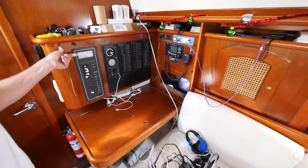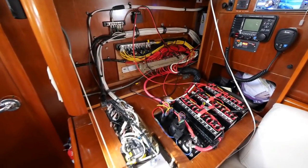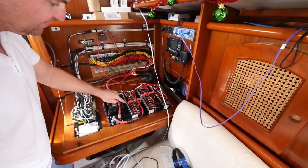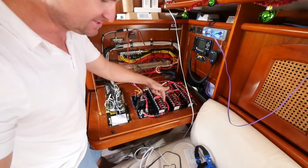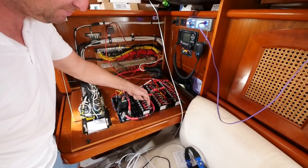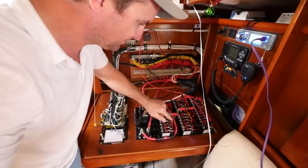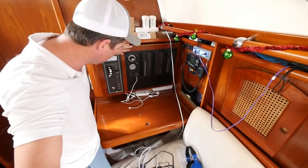Let me show you — it's pretty awesome. This is our electrical panel, brand new, looks nice and neat. This is everything behind it. It's really nice because this isn't too hacked into — I've run a couple extra lines for our LED lights into a switch. These are your breakers right here, these are your hot buses, powered by 12 volt DC. You've got a bus there and it hops over to the next bus. These breaker switches, when you turn them off and on, run power from the bus through the breaker to the output terminal — that's where you connect your line to whatever feature you're running. Over here is your negative grounding terminal, you run a line to each one and you have power. These are almost all five amp fuses, so you're protected — you don't catch fire, you don't blow anything up. It's important to run everything through that.